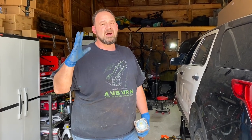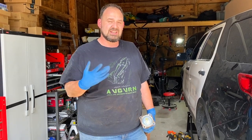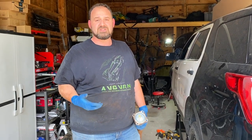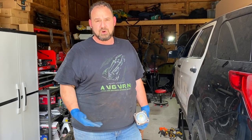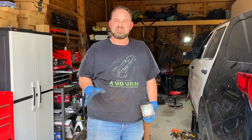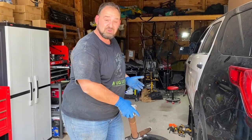So, my buddy Chuck was over here when I was working on it. He crawled underneath and he said it looked to him like the transfer case was spinning, but that the drive shaft itself wasn't, which was also mirrored by the fact that the front wheels were turning, but the rear wheels weren't. So today, Doug came over here with me, and we did some experimenting, and we're pretty sure Chuck was exactly spot on. So what we did is we had to pull this drive shaft out.